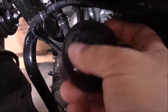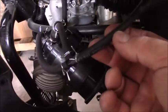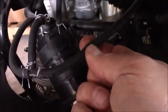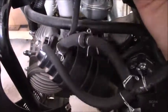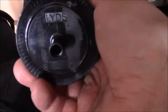As long as that device is working properly, the only other difficulty you can have in this system is one of these lines being pinched off. That sometimes happens because when assembling bikes, people get a little overzealous with zip ties and simply strangle the line — putting it just too tight so the line kinks or bends inappropriately. Check all the lines, run your hand through them, make sure nothing is kinked. If your lines look good and you put a little WD-40 in here, you should be a hundred percent.